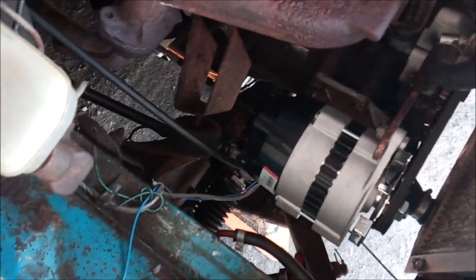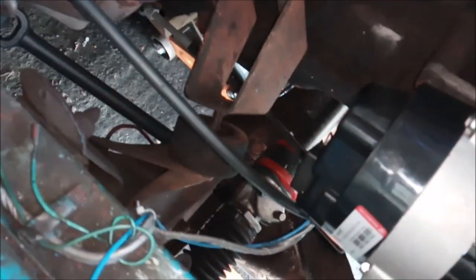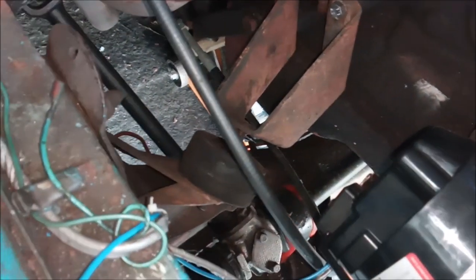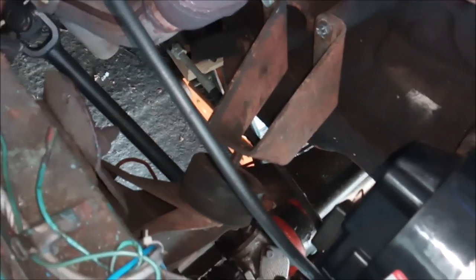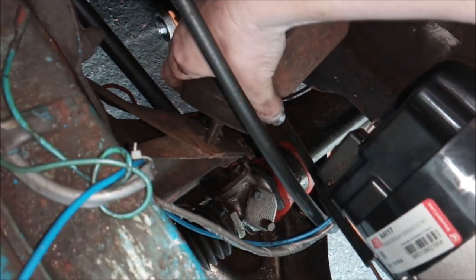Now, the balance of the engine wasn't quite right, so it was lifting more on one side than the other. So, hang on. There's the mount. Can I get it out? Not just yet, no. So what I've been doing is using my foot on the jack, sorry about this, it's wobbly, and I'm trying to keep an eye on this hose, as well as jack the engine up to get this mount out.